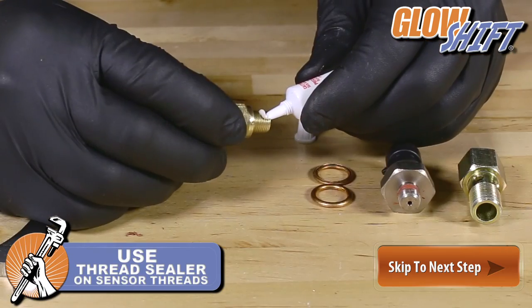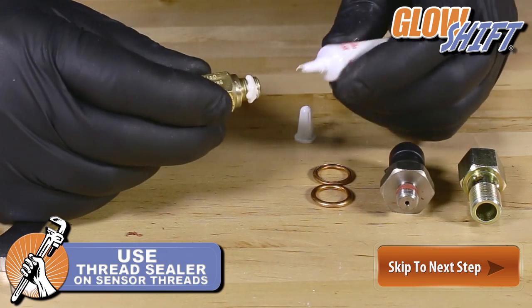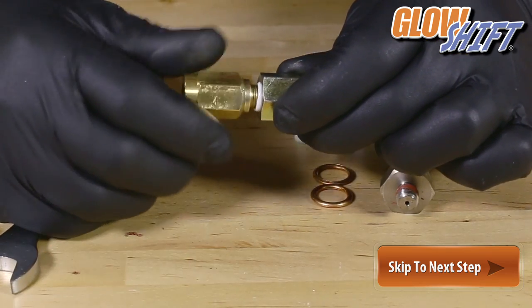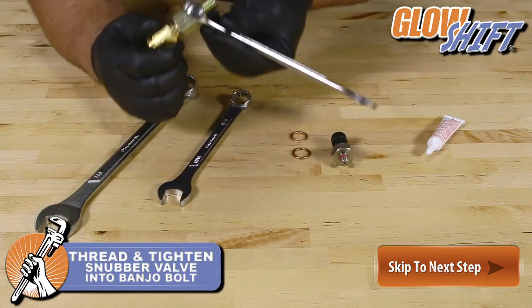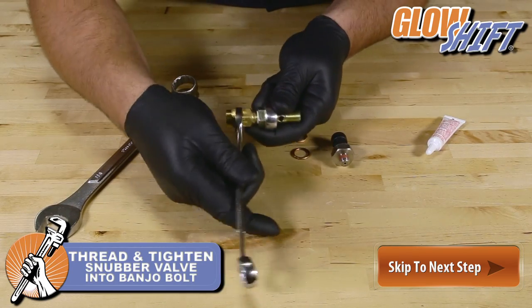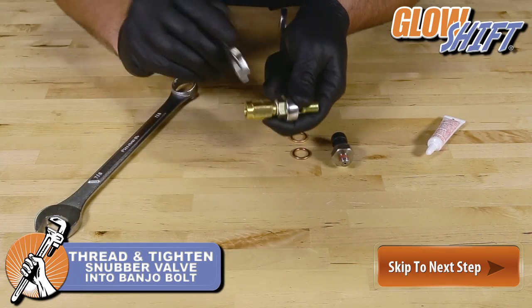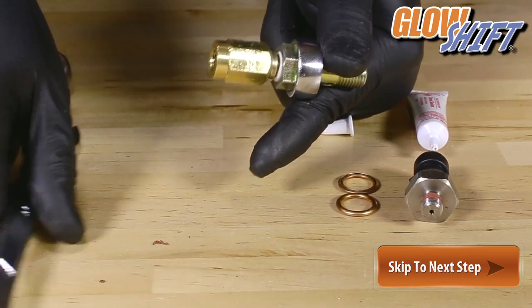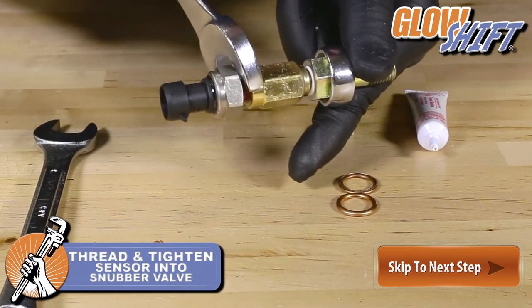Use thread sealer on the snubber valve thread. Then thread the snubber valve into the banjo bolt and tighten. Now, take the sensor and thread and tighten it into the snubber valve.